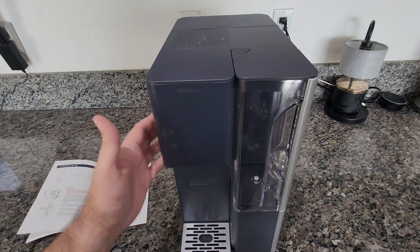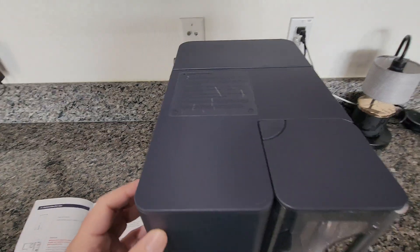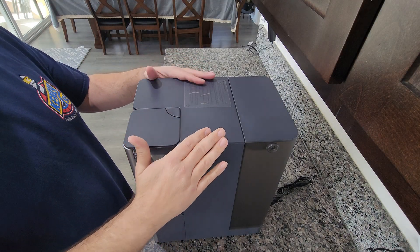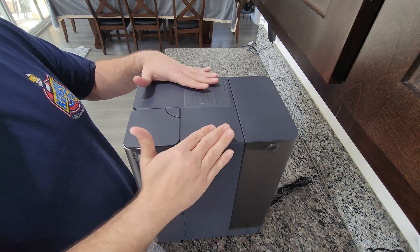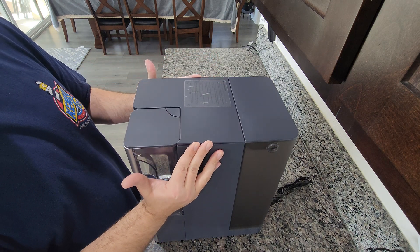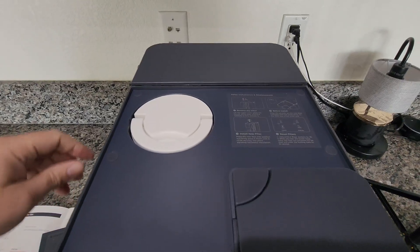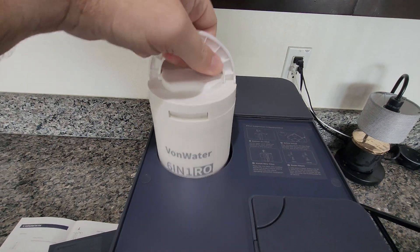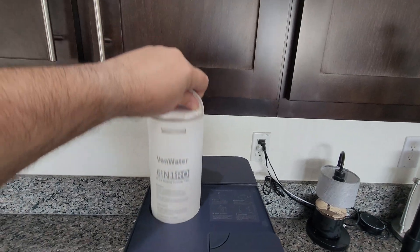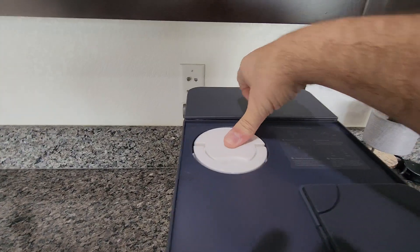If you don't want to hold on to the manual, there is a sticker right on the unit that has those instructions — just leave that there and it'll give you a general idea of what to do. Before flushing, I'm going to check the filter area to make sure there's no plastic on it. To remove the filter, remove the top portion by pushing up on it with both hands — the lid comes off revealing the filter. Lift up on the handle and pull it up. It's a massive filter, bigger than the one I use on my refrigerator. To put it back in, line up the grooves on the side and give it a good push until you hear it click.